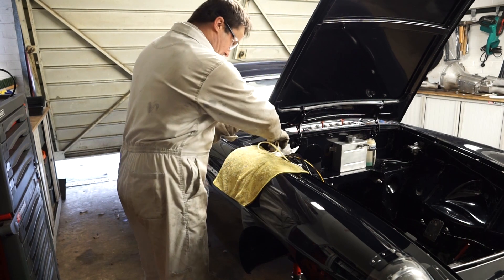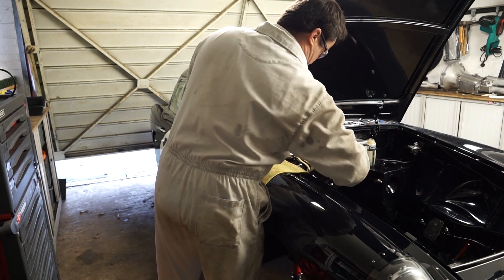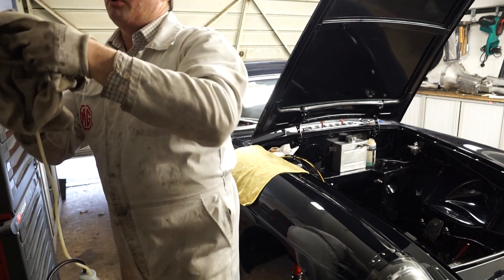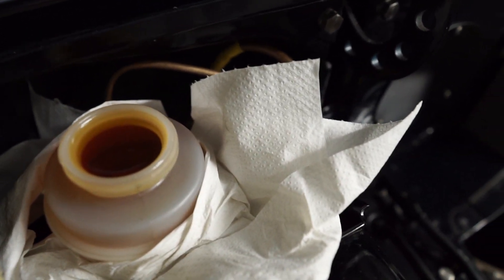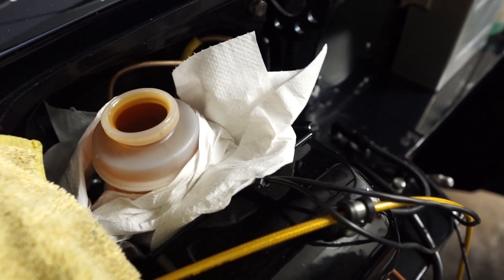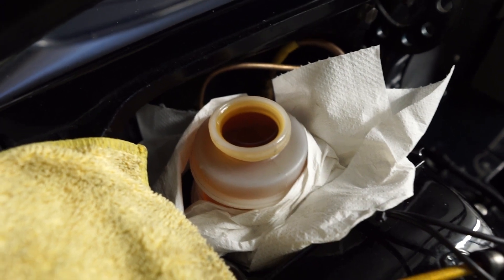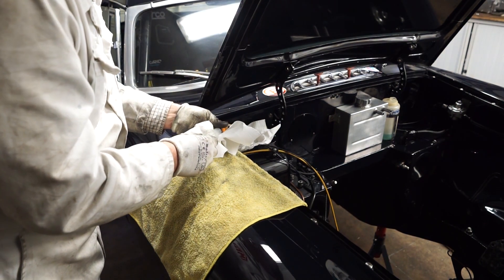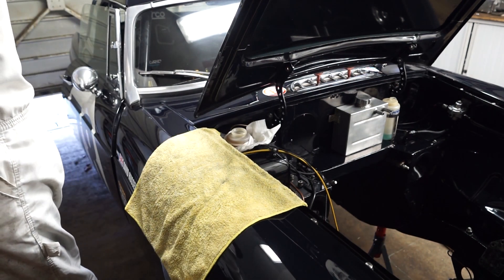I've got a cloth at the ready. I'm just going to take the Gunson's Easy Bleed cap off the master cylinder and let that drain back. Be very careful when lifting it away from the car not to spill any. You'll be able to see that the Gunson's system has filled the master cylinder all the way to the top — I don't want the fluid that high. I tend to run the car with the fluid on the minimum level, because as a race car the fluid does get hot and in the past it has expanded and come out over the top of the master cylinder. So I'll get a syringe just to take that top of fluid off — very carefully draw it back up into the syringe and put it back into the brake fluid bottle since it's nice and clean.